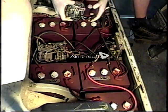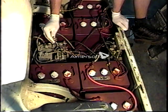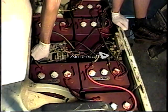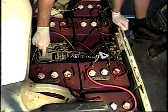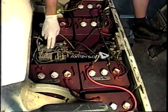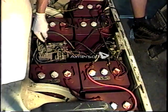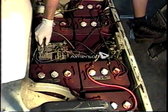To test this, we disconnect these two cables and probe them with our ohms meter. Any car with a black anodized controller will show less than 500 ohms at rest. As you activate the potentiometer from rest to full acceleration, this will range from less than 500 ohms to over 5,000 ohms. On many club cars and other cars that have a silver anodized controller, it ranges from 5,000 down to 500. If you're not getting a good output at this terminal, go ahead and test your potentiometer with your ohms meter.